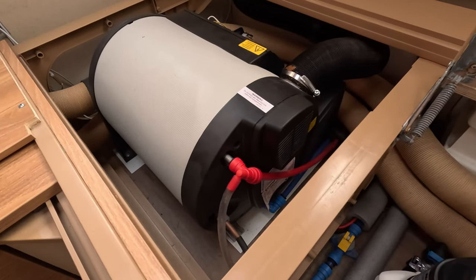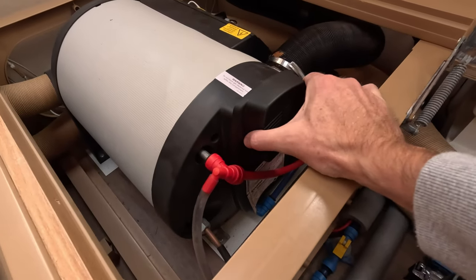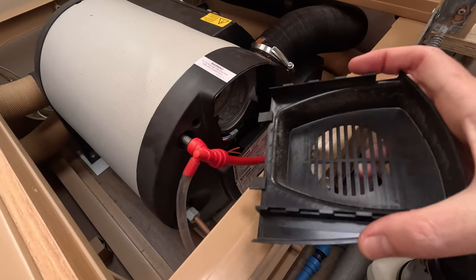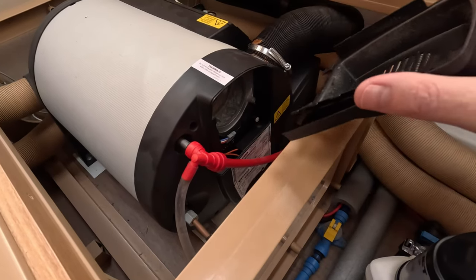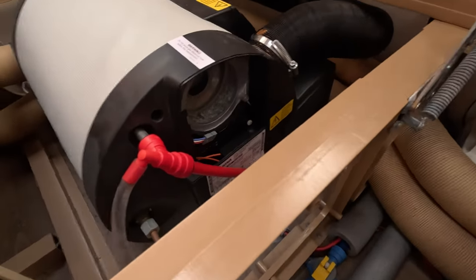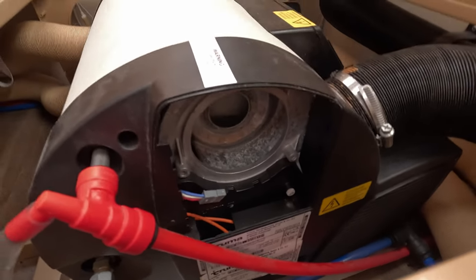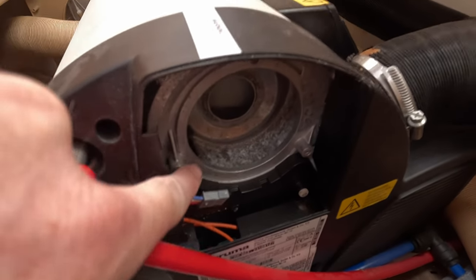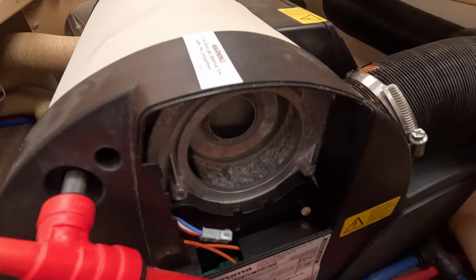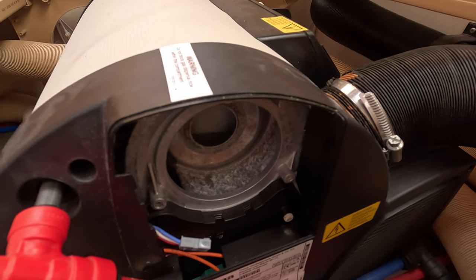It's been a couple of days now because I went and ordered the replacement part — the fan unit that sits in here. To get this part out it's just a case of lifting this up and gently moving it out of the way. You've got these different catches here, so you don't need to keep pulling it right up, just a little bit and it will slide out. It also gives you the opportunity to give it a good clean. The fan unit is held in by three T20 bolts — one here, one there, and one at the top. Once you've unclipped the electrics it just pulls out quite simply. It's a T20 Torx bit that you need to replace this part.